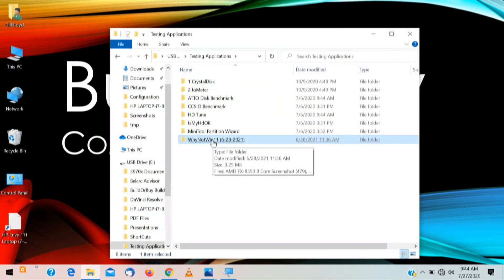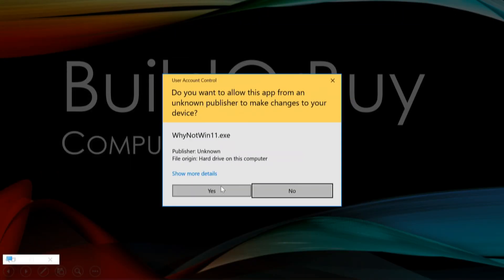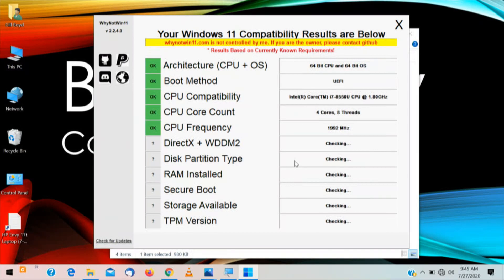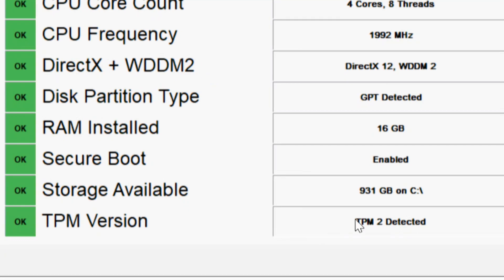After this, we're probably going to take a look at an Intel NUC that's about four years old and see what it's got. I expect it's going to work, but I want to verify. So right now we need to run the test — WhyNotWindows11. We've already run the test on three other computers, so let's run it now on this one. Everything is going to check out, except this is interesting. The first time I ran this test it said TPM was okay but did not show TPM 2.0 was detected. This time it does, so everything is good to go. All we have to do is go into the BIOS and enable that feature.